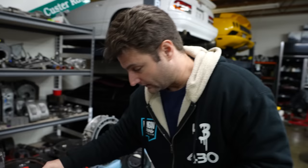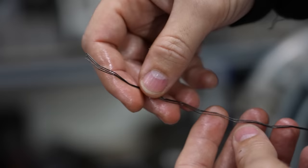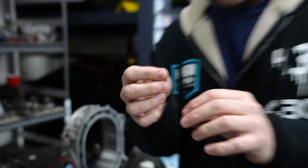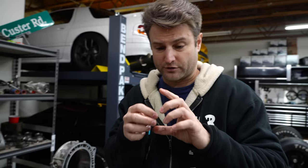I also noticed I had a couple springs behind those. It's really easy with the bigger the motor is, because you now have kind of a control group, and you'll start seeing some of these ends are flattened. These are FC side seal springs. They're like $4 a piece. They're relatively inexpensive.